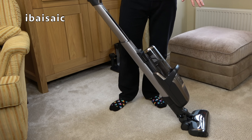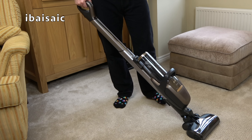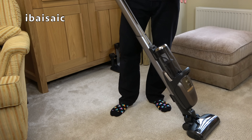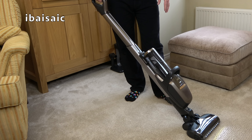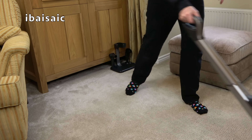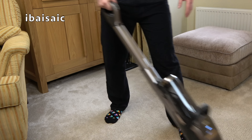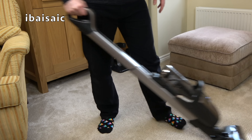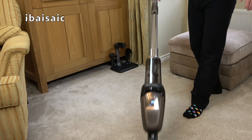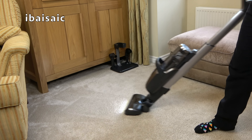On this particular pile, although the brushes are rotating, it is struggling a bit on medium. In my home for this particular carpet I think I'll have to use this machine on its minimum setting — let's try that. On minimum it's fairly easy to push, but the brushes are still stalling ever so slightly. It's nice and quiet though. It does seem to be skipping across the carpet a bit and doesn't seem to be giving a deep clean.